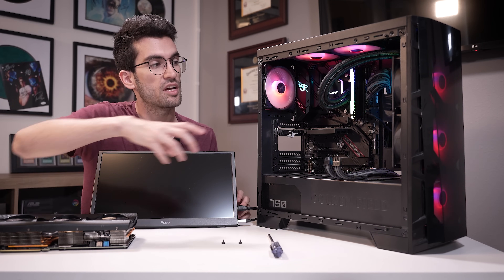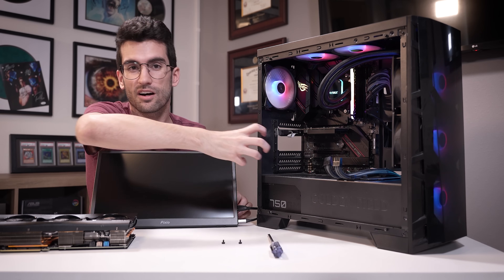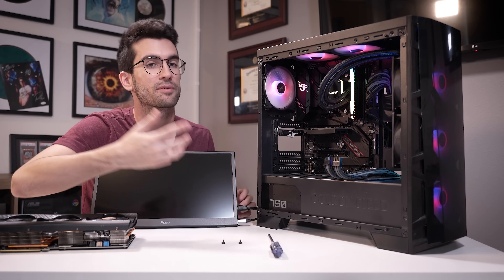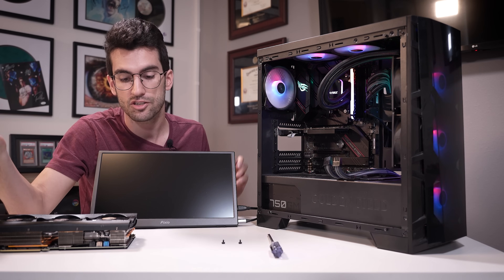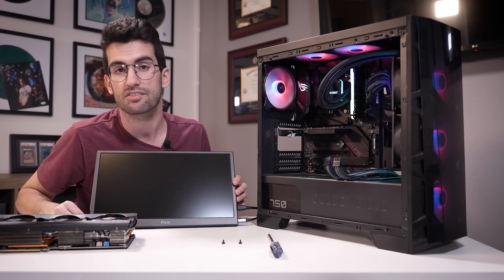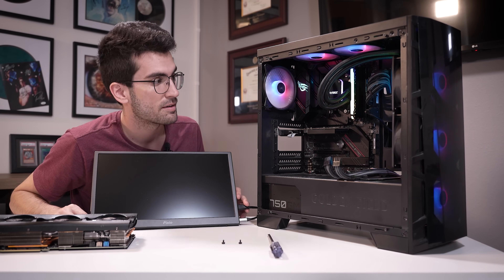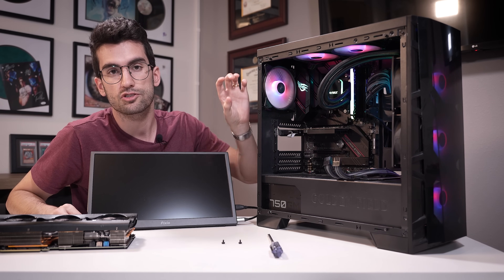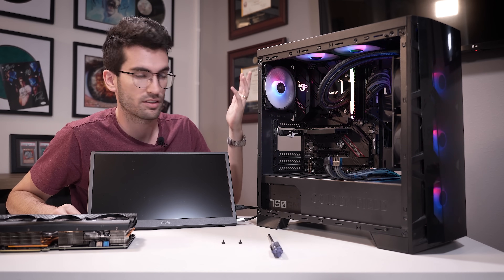It's possible that when he was removing his CPU cooler, maybe he tugged or twisted too hard and bent some pins on the chip — it's sometimes what happens with PGA unfortunately. AM5 seemed to solve that, but then AM5 has its own issues, so we'll see how that fares in the long run. I'm going to take the cooler off, check the CPU, and check the socket to see if anything's wrong.